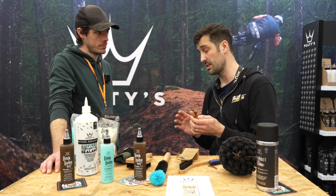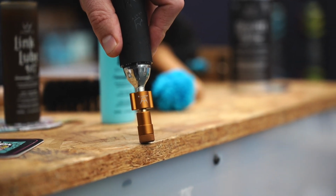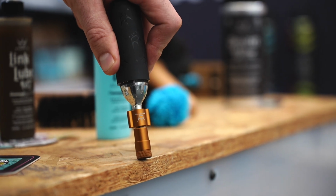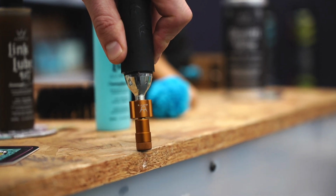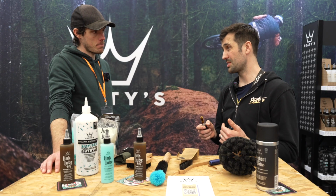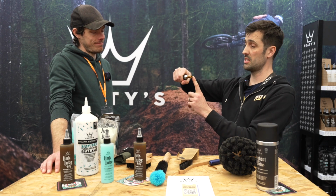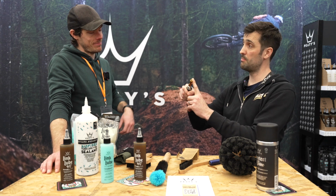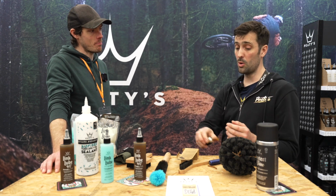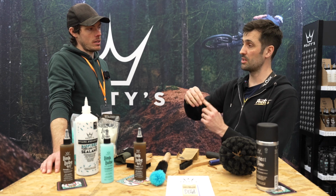There's a lot of CO2 inflators out there. We do a valve for life guarantee on our tubeless valves. So if you buy them and you snap them, even in a crash, we'll replace them for free. But we get the feedback of why people break them quite a lot of the time. A lot of the time they're from 90-degree bent CO2 inflators, torquing the valve by mistake. Or fixed head pumps, trying to pump them and they just fatigue the metal and they snap.